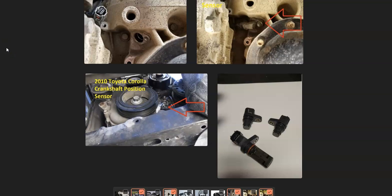So what do you do if you have a Toyota with the P0335 code? First, Google where the crankshaft position sensor is located on your particular Toyota, since there can be some differences. Locate it, check out the wiring, and be sure there are no opens, shorts, or anything like that. If it's not getting power, check for a blown fuse, as that's a very common problem — it could also be an open in the wire. If the wiring all looks good and there's no blown fuse, replace the sensor and that will usually solve the problem.